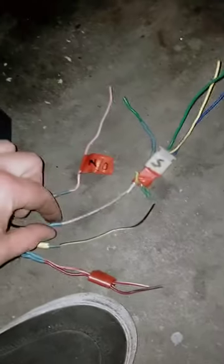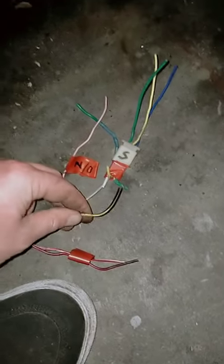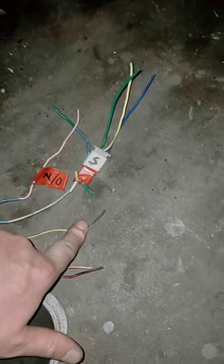This goes down to your stator. The stator is connected on here, and you have one wire that goes onto your CDI and goes on, off, on, off — and then is controlled by the CDI for when it turns on and off the spark wire. Whenever you look at something from China it's always going to say high pressure — that's the term they use; other people might say high tension. This isn't actually high pressure; it's 12 volts, but it turns on the power to your high tension circuit. High tension means high voltage. That is simply connected straight onto here and basically turns on and off your spark plug.